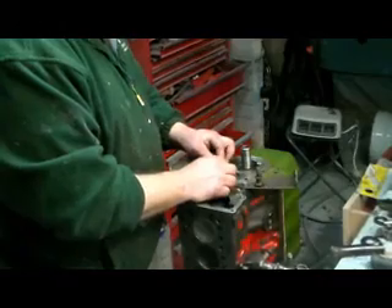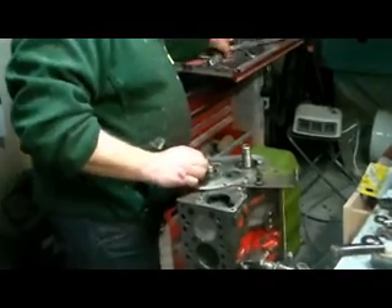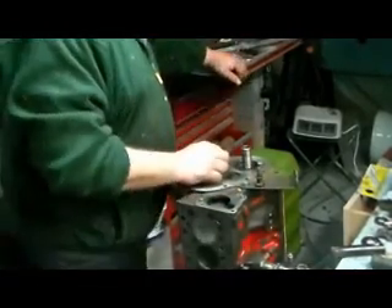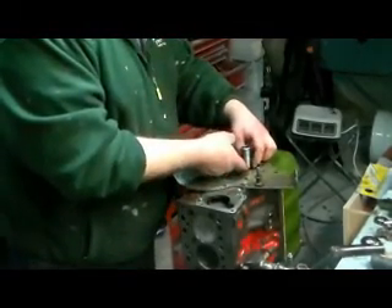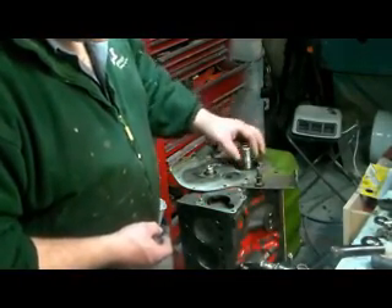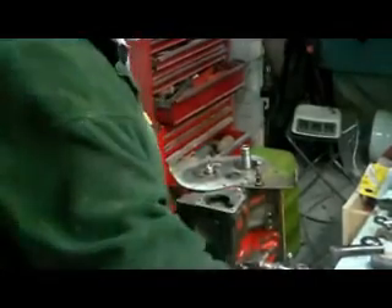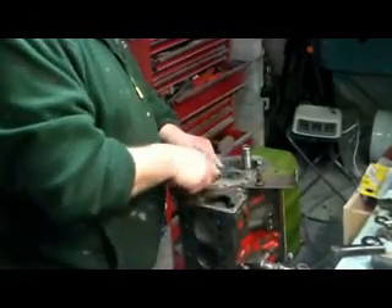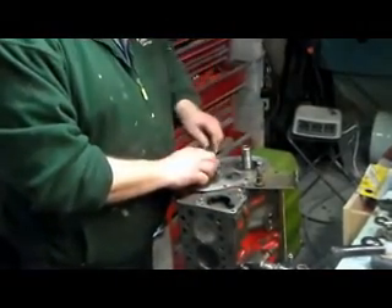The timing gears have to line up, and you do that with a straight edge and some packing shims which I've already dropped in there onto the crankshaft. There are packing washers going in there - packing shims - just before the woodruff key goes in. You basically put the timing gears together, put the chain around the gears, line up the pulleys, and pop them in together.